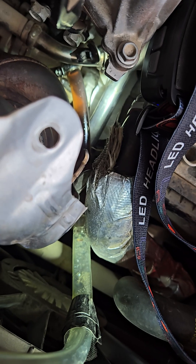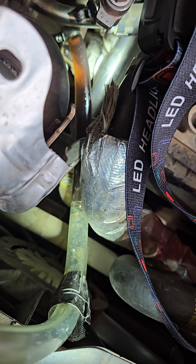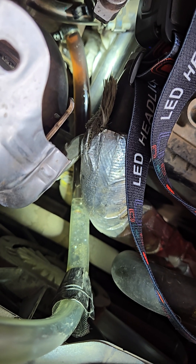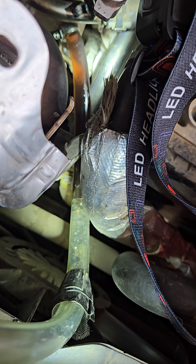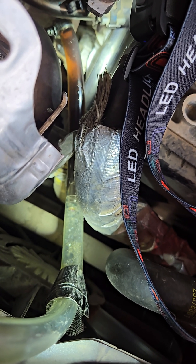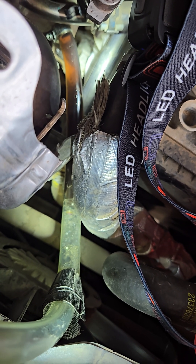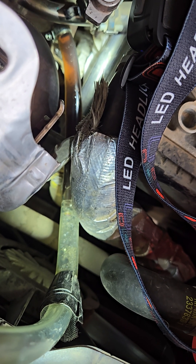The reason is if you do not neutralize that purple power, it's going to get sticky and anything that's alkaline is going to adhere — dirt, carbon buildup. Then you wonder why your EGR valve or EGR cooler is clogged up again less than a year later, because you didn't neutralize and rinse out that alkaline purple power.